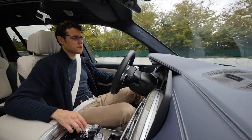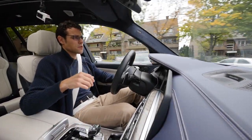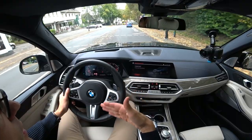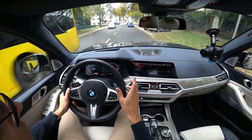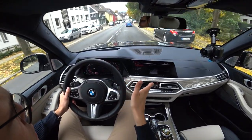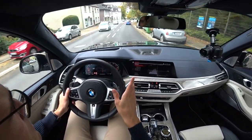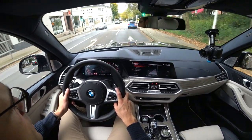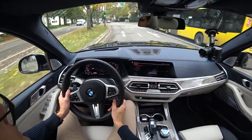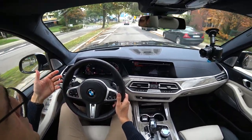You can pick different driving modes — in sport mode there's an even stiffer setup, which is really sporty. The rear axle steering makes a significant difference: 3.5 degrees in parallel or opposite direction from the front wheels. At lower speeds it's opposite direction, improving agility; at higher speeds parallel direction gives stability. The changeover happens around 60 km/h in comfort mode and 80 km/h in sport mode. If I were going for an air suspension, I'd usually want that special soft air suspension ride feeling — so you can argue both ways.